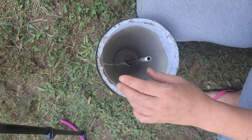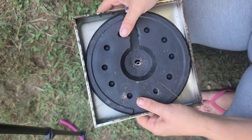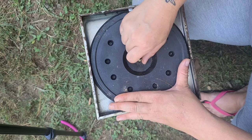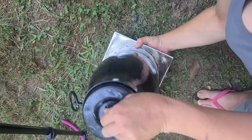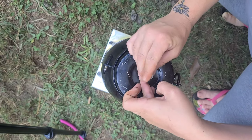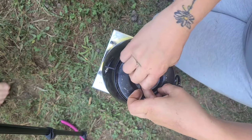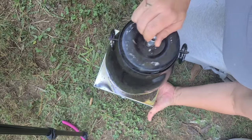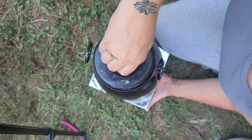First thing you're going to do is put your rod back through the main part of your lamp, then attach your base. My base had two parts: a round one and then a square one. After I get the two parts of the base back on, I'm going to thread one of the nuts onto the bottom of the lamp. Now flip your lamp back over — this might take a minute. You want to hold onto that rod at the top as best you can so it doesn't fall back through. Then take your female coupling and tighten it down on top of that male end of your rod. Build your lamp up so you can get your hand under it and grab that nut on the bottom — this is going to help you tighten down your coupling.